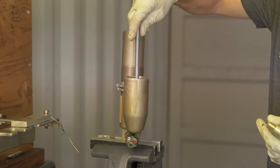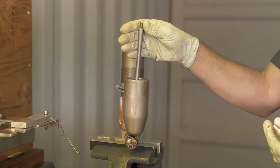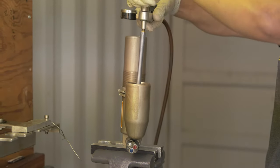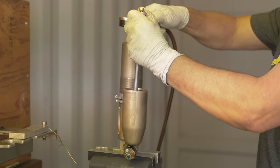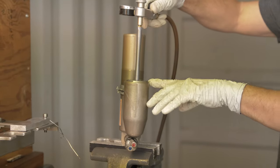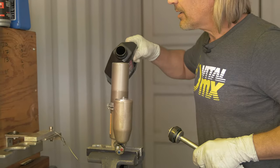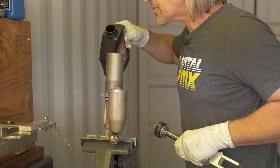I'm going to partially fill this bladder — I'm going to put 40 PSI in here using nitrogen, though you can use air or even a hand pump at this stage. Because this shock has a really odd Schrader valve stem, I have to use an adapter. Once it's filled up, the bladder is going to expand and seat itself — make sure everything is even and the bladder isn't cockeyed. Now that the bladder is seated, I can go ahead and fill the main chamber up with oil, about two inches from the top.